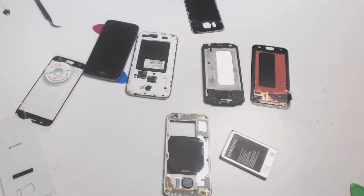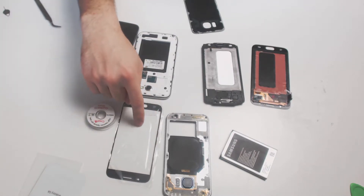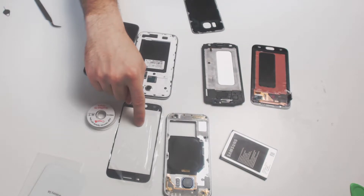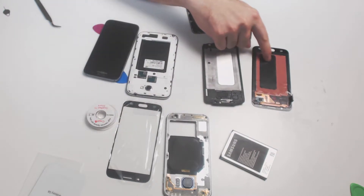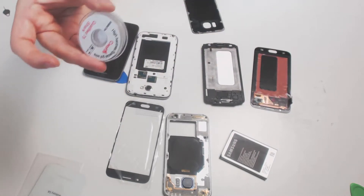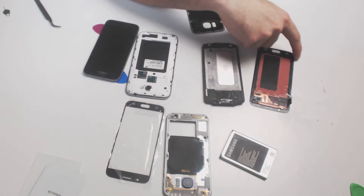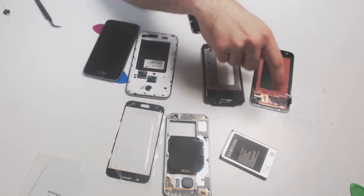Now, it is possible but unlikely that you are here to find out how to replace the glass when the screen and touch behavior are working without error. You'll see here that the glass panels, which cost around $15, can be purchased separately from the digitizer, which usually costs north of $100. These two can be separated using a thin diamond hard-cutting wire, like floss, shimmying from the corner across the panel to disconnect the two.